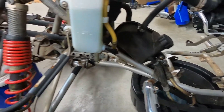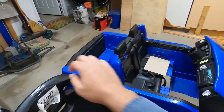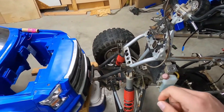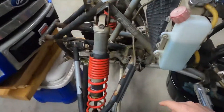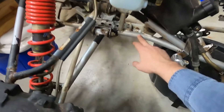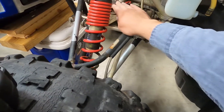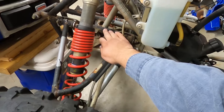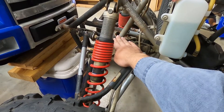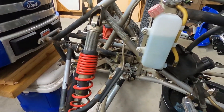And so by making them longer, I could then bring it out longer here because the wheelbase is different between this and this. So I think today what I'm going to try very hard to do — it might take some trial and error — but at least make these bottom two frame rails. And if I can make the standoffs and these runners right here, that would be even better. And what this will do is let me put the engine here and make some mounts for it, then put the body on and reevaluate what the height looks like.